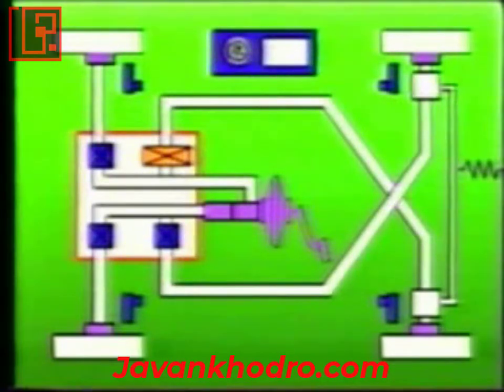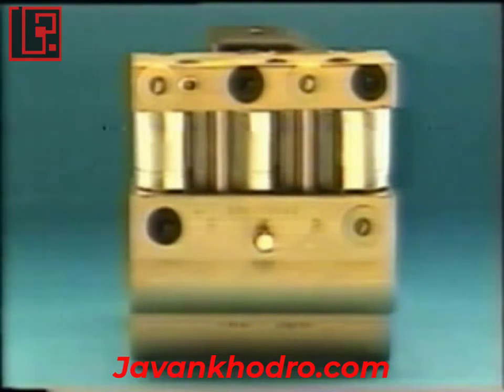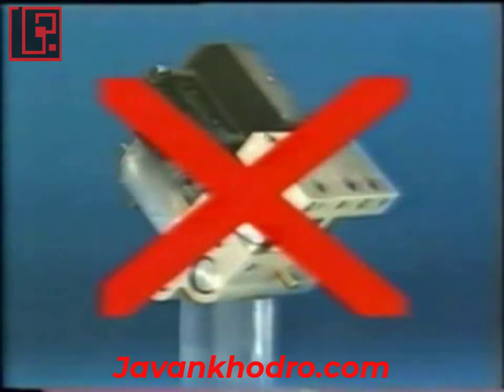Due to the equalizing valve in the 2E system, there is a specific bleeding procedure for the 306 brake system. You must start with the wheel nearest to the master cylinder — the front left-hand wheel — then bleed the front right-hand wheel, the rear left-hand wheel, and finally the rear right-hand wheel. When removing the additional control unit, it's essential to put on the caps. If this isn't done, the brake fluid in the plenum chambers is likely to flow out and bleeding becomes impossible using conventional methods.